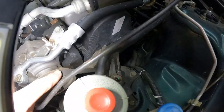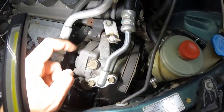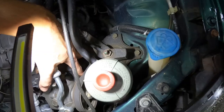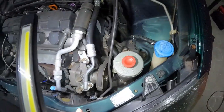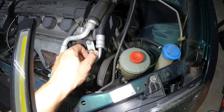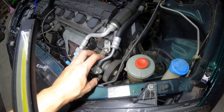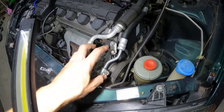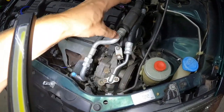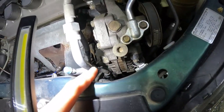Before we can do that, we've got two belts. The first one is the power steering belt. There are two mounting bolts — one here and one down here. You want to loosen those up and then use this wing nut to move the power steering pump down so you can loosen it enough to get the belt off. We might end up getting this thing more out of the way depending.